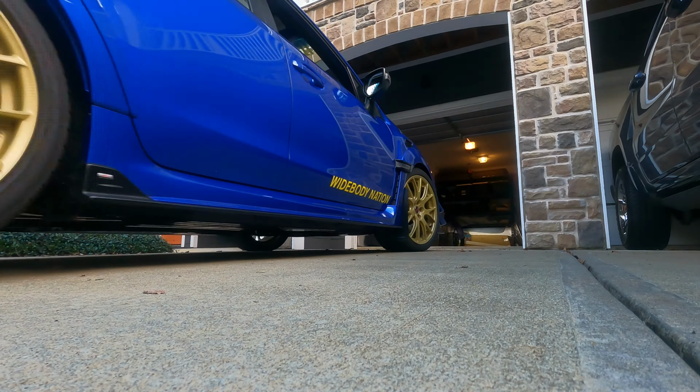I bought the full kit, although my shop that I used obviously told me that we were already switching some things out. So obviously we still have a flex fuel sensor and a fuel pressure regulator. We had to change out the fuel pump, but the injectors and the fuel pump are the two big things I want to talk about. So first thing, injectors. We are running the 1300 cc injectors. Now 1300 cc injectors, as many of you know, are a level up from what most people kind of default to when they start upgrading their fuel system.